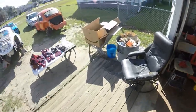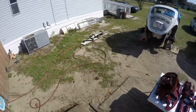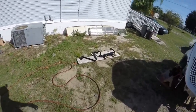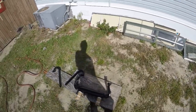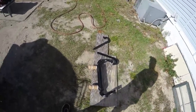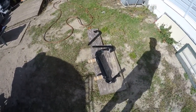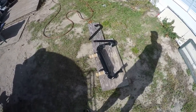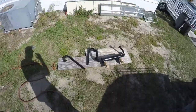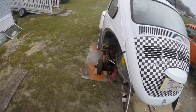The new exhaust has a rust inhibitor on it. This will just instantly burn off when you crank the motor up — the instructions recommend it. A lot of people don't think about it; they think it's all pretty and black. So we're gonna put some paint stripper on it, get all that off, and paint these with some high-temp low-gloss paint.